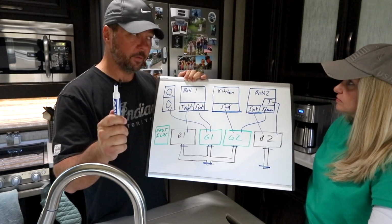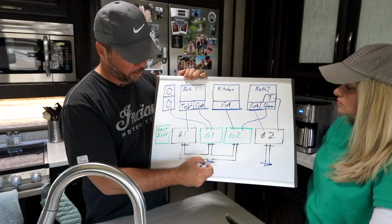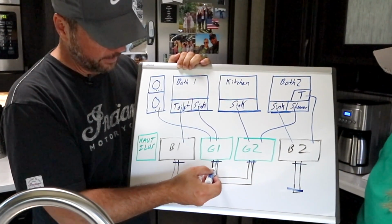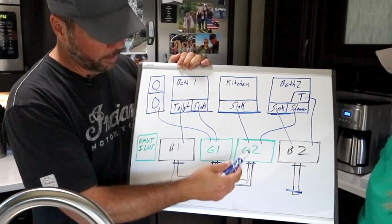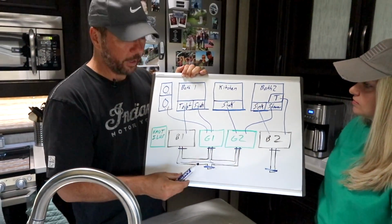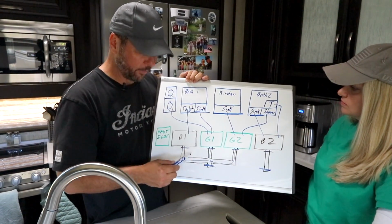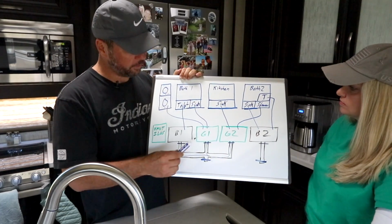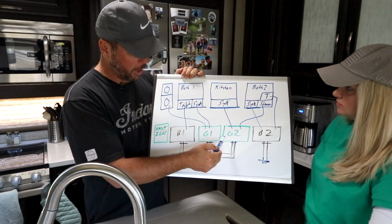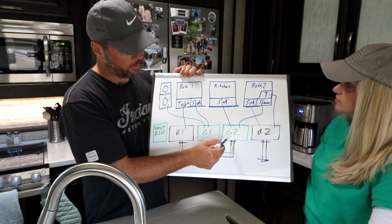The other benefit, and leads into this tip, is what we'll do when we're boondocking is we make sure this is closed, and then we open both of these, and what happens is they bleed over, fill this system up down here, and essentially balance each other out. So what we end up with is one giant 108-gallon gray tank plus whatever's in the pipes. We get quite a bit of extra usage for our showers and stuff. We can actually, by means of this bypass, have shower water go into here. Since we're taking our dishwater and dumping it in here, we have lots of capacity there.